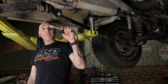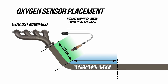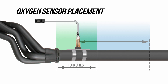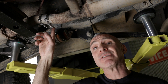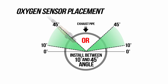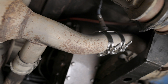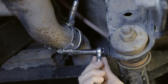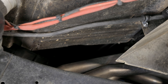Our Atomic 2 ships with an OEM grade Bosch O2 sensor. It needs to be mounted as close as possible to the engine after the cylinders have merged — this holds true whether you've got exhaust manifolds or headers. Our Bronco has long tube headers so we'll mount our O2 sensor right after the collector. You need to be sure you have at least 18 inches of exhaust after you mount the O2 sensor. Our Atomic 2 kit includes a stainless steel clamp-on O2 bung with a high temp gasket. The O2 sensor needs to be mounted between 10 and 45 degrees upward from horizontal. We used a 3/4 inch step bit to make our hole. Don't forget to position the gasket under the stainless steel bung while slowly tightening down the clamps, then install the wideband O2 sensor. Make sure to secure the harness to prevent contact with moving parts and high heat areas.